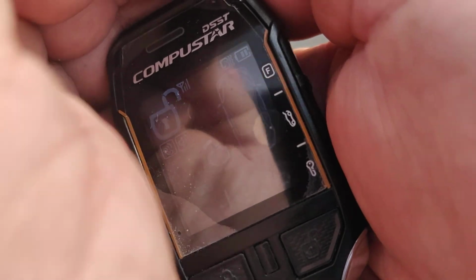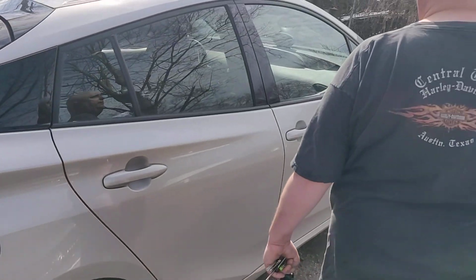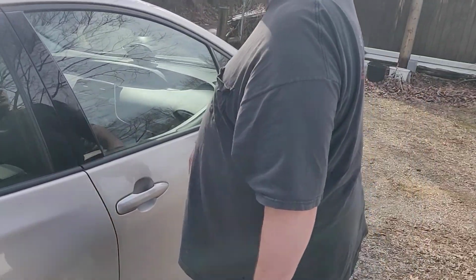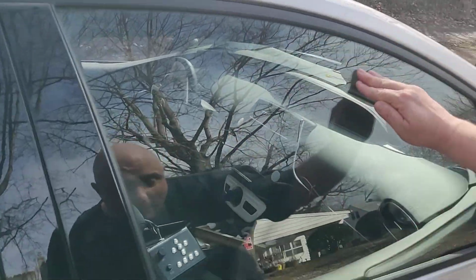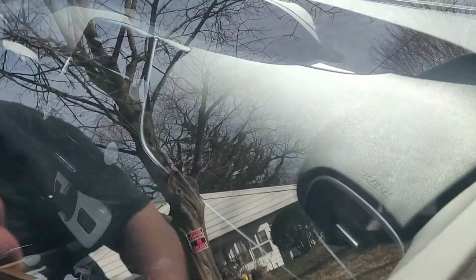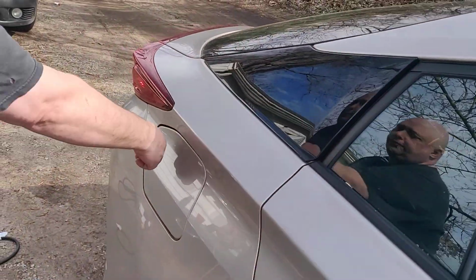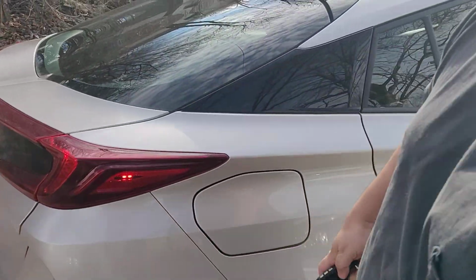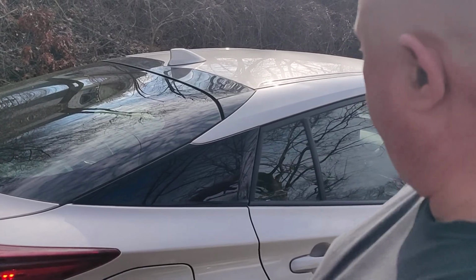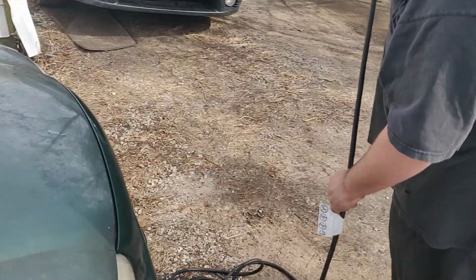Okay, now, because the plug is removed from it, if you look, it's a completely different scenario. The remote start now actually is a full remote start. It's hard to see in the light, but it does say ready up in there. So the point of this is that as soon as you close the door and hit remote start again, then you can put your keys in your pocket, and while the car is still remote starting up, that's the time you put your plug away.